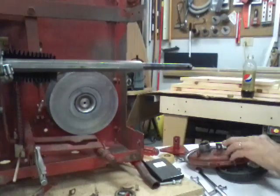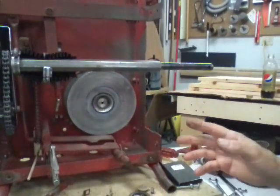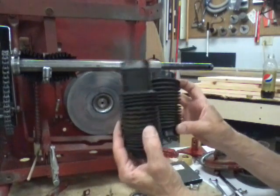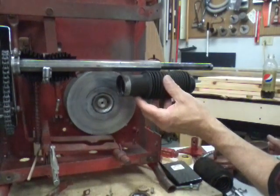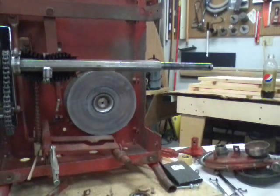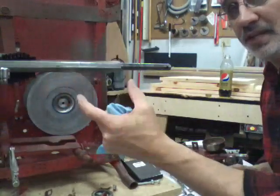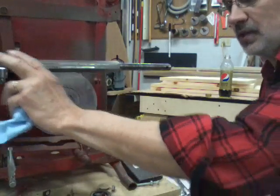Now you can take the remaining clamp off and replace your boot. There are a couple different styles — I've got some old greasy ones here to show you. There are two different styles. The one with the long extended end typically goes on this side of your chain case. If you put it on the wrong side, it won't let the chain case slide over far enough to get into fifth gear. A reviewer emailed me saying he couldn't shift into fifth after installing new boots — he likely had the extended-end boot on the wrong side. He'll have to switch them around.